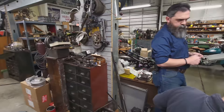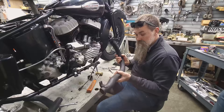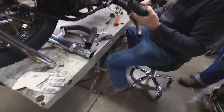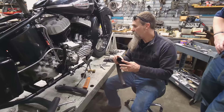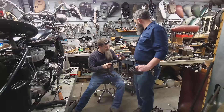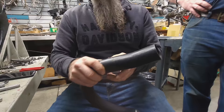I'm trying to visualize how we want to do this. What we've got here is just not a great fit — aftermarket pipes, not just the best available but only available aftermarket pipes. Every time they fit a little bit different. You look at all the bends and tweaks in a pipe like this, which is pretty much a replica of a standard UL pipe. This bend here is not just a curve, it's kind of offset a little bit too. So we've got another inch to inch and a half to make up. We'll clamp it real nice, weld it, clean it up so you don't really see the welds. I've got a piece of the same pipe — I would almost use this side because it continues the curve. We're going to lop a bunch of this off and start from there.